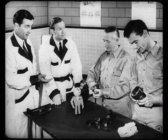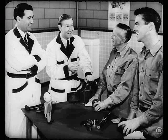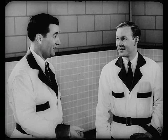Well, now that just about covers how you take the overdrive unit apart. Once you've got the overdrive disassembled, clean all parts and inspect them for damage or wear. And if there's ever a gear tooth missing, don't come running up to me asking for a false tooth for the gear — bring up the damaged part and I'll give you the right replacement. I won't let these jokers pull that old gag on you, Hank.